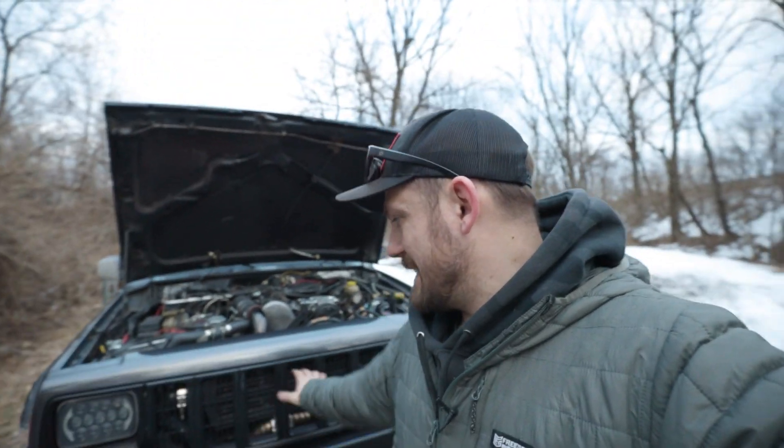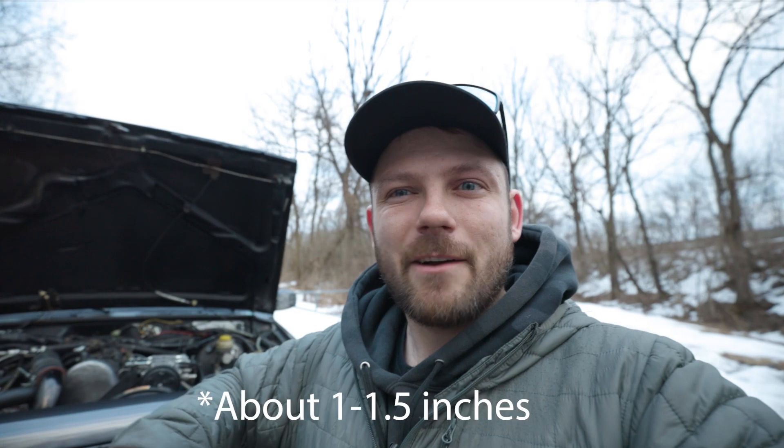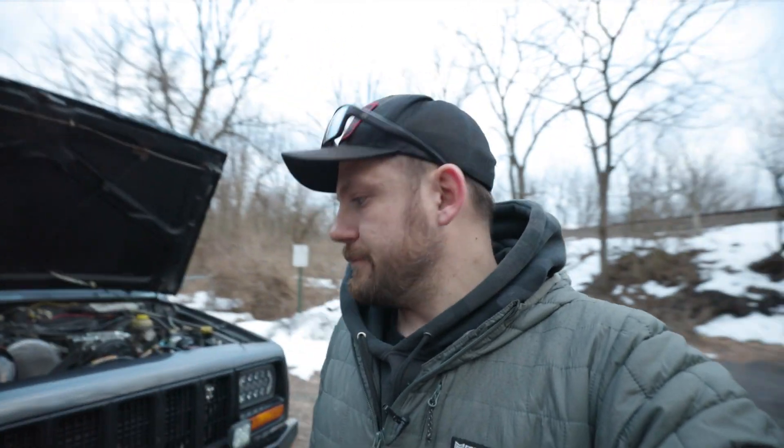As you can see it's not a hundred percent straightforward. I did fit this into the front of my Jeep, I did space the radiator back a little bit, and I am running a Mishimoto oversized radiator. There are a lot of questions about what can you fit - if you run a front mount intercooler on a Cherokee, you're definitely going to have to space that radiator back a little bit. But it is possible and I proved it with my rig. It's just none of it's going to be easy. If you're going to run more boost and more fuel, you definitely need the intercooler.